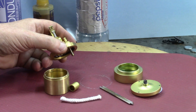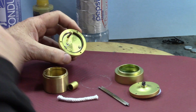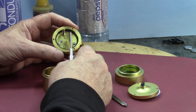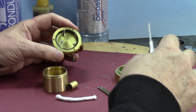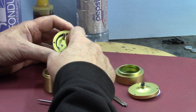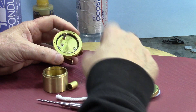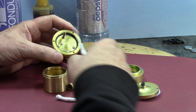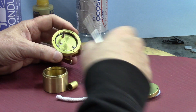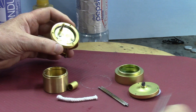And you got the safety valve underneath, which you check to make sure it's operating freely — that's an important thing to check all the time so you get no overpressure, no explosion. There's also an o-ring here underneath. Something to be careful about — just put it back in place properly. Make sure there's no kink, no fold, so it's properly in place.